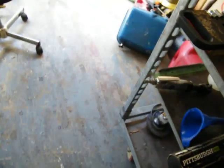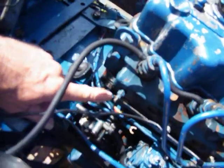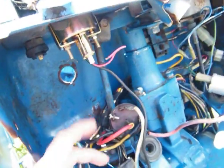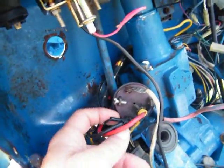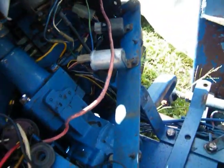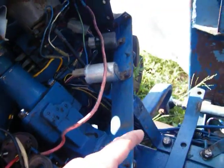That's what we're looking for. The way this thing hooks up — it's not right. Somebody has this backwards right here, because terminal 50 could be over here. The glow plugs should be on 17. Let's see — 19, 17, and 19 — these should be the glow plugs, 17 and 19. Terminal 50 should be the safety starter switch, which is on the clutch.